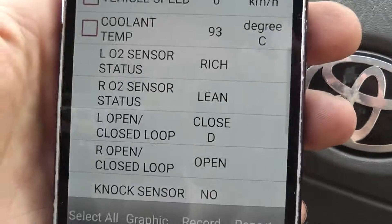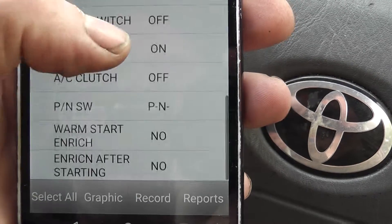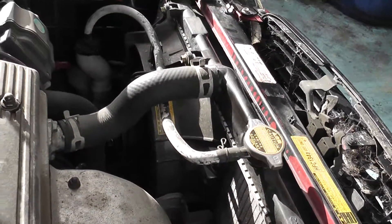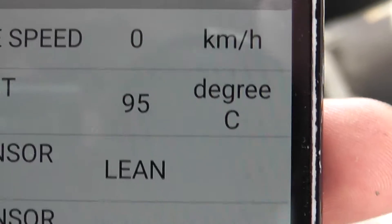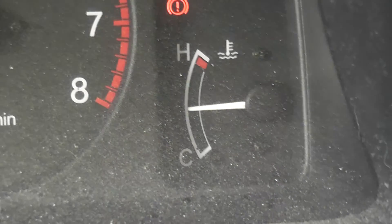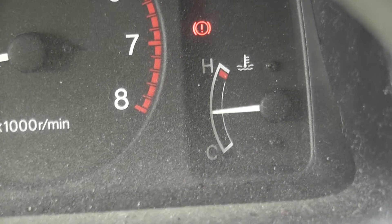And you will never see it here — it'll just blow up. Can you hear it? You can hear the fan, you can see the fan running. We have 95 degrees Celsius — then 93, it just cooled down. That's what you see on the gauge: halfway. So the driver doesn't get scared that you have 100 degrees water in your engine boiling away.